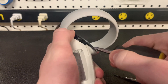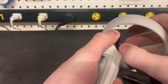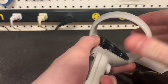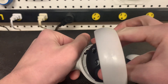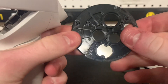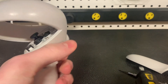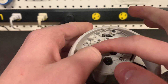Go around the sides and edges. Once you have most of it off, slowly peel it over, put the screwdriver in the side here as well, and there you go — slowly take it off. Don't go too hard, and it should pop straight off. Try not to break any of the three plastic pieces — this one, this one, and this one — because it won't clip back in if any of those are broken. Once you have this top off, you now have direct access to the joystick.